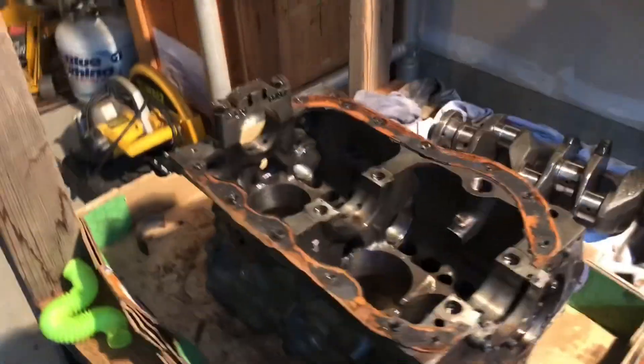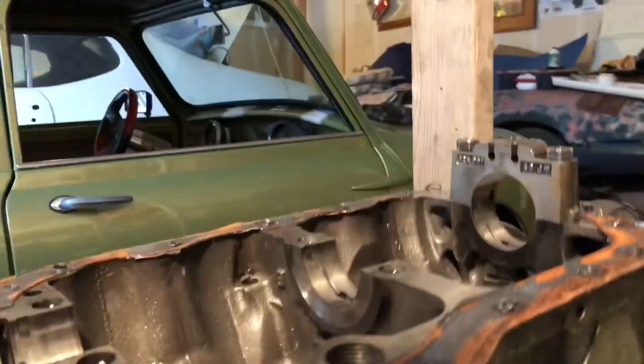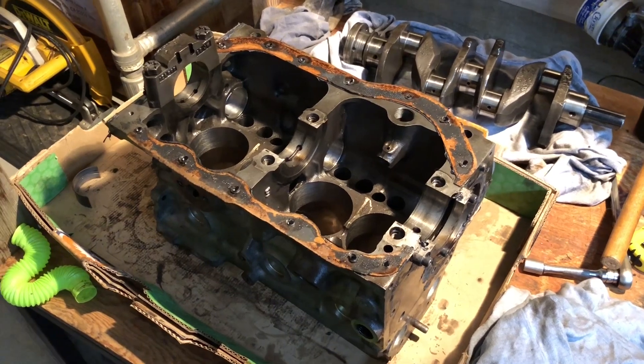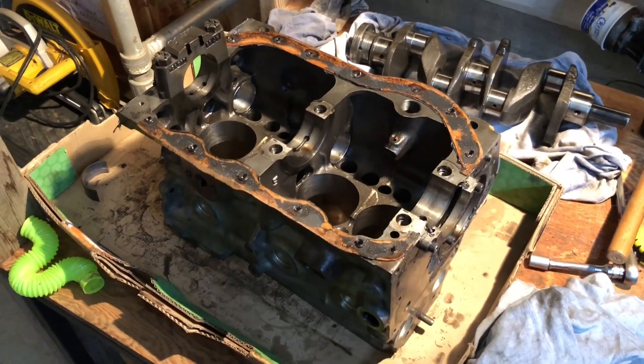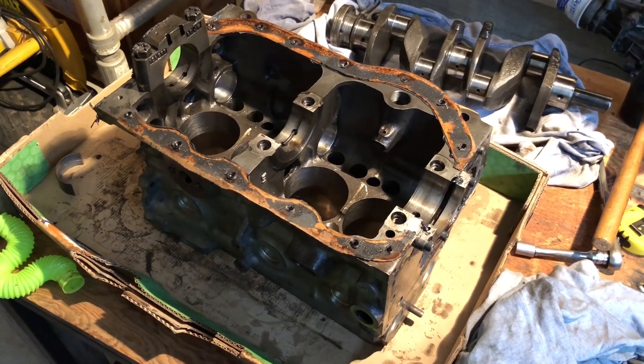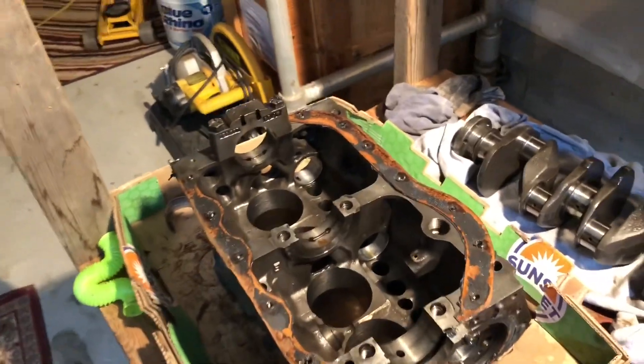We took this engine apart. This is an early Sprite block, a thick flange. We know it's early because it lacks the fuel pump opening, and a lot of these for the Sprites never intended to use a mechanical pump, so they didn't open the blocks up. We are going to open it up as we did the other one for installing the breather. Very critical to have good crankcase venting on these when it's a race engine.